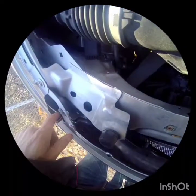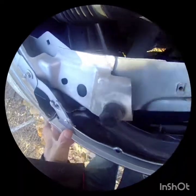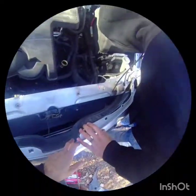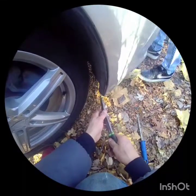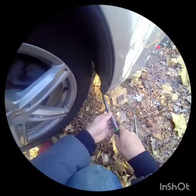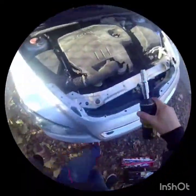You can see two screws here holding this part of the bumper. Then you got this metal frame here — there are three plastic tabs that might be a pain, but you'll get it. If you have to break them you can always replace them. There's a 10 millimeter under here — you got a hole here, just line it up and pop it out. You can pop this corner out now.